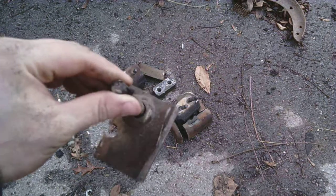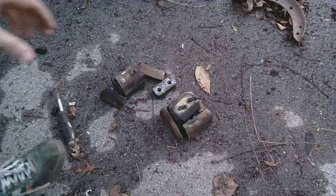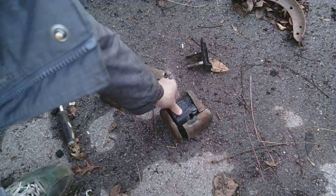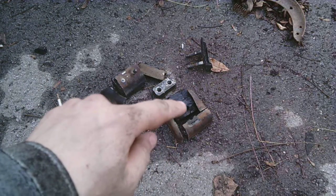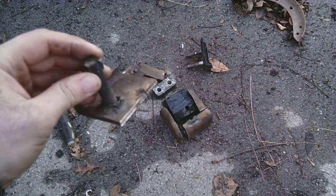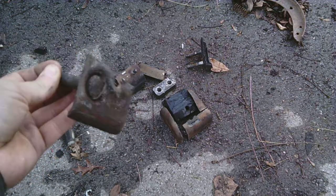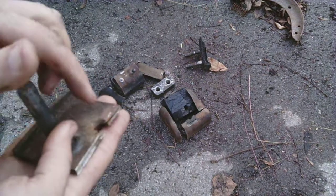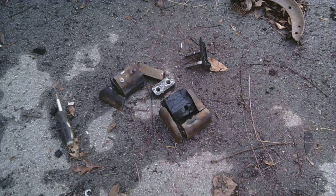You would think this would be simple because you see this bolt here. This bolt passes through that hole right there. After you cut the steel away, you see that hole right there, and oh, that's great, I'll just cut the head of that bolt off and it'll come out. But that doesn't help you, because the bolt goes through this backwards and is tightened here or riveted or whatever. So when you cut this is on the frame, and then the real bolt that's holding it is here, and it's very short. So no matter what, you have to saw through all that rubber.